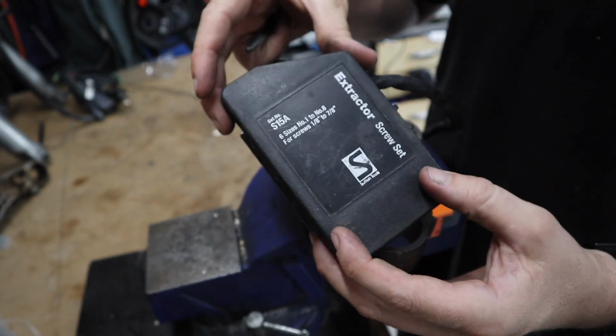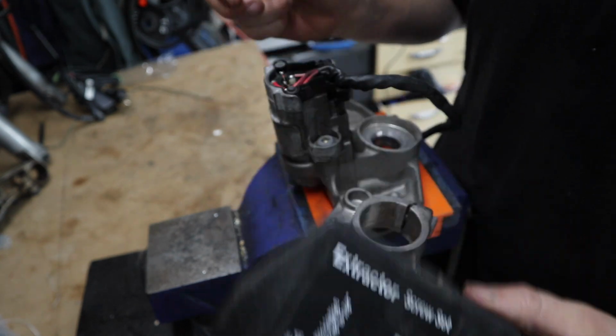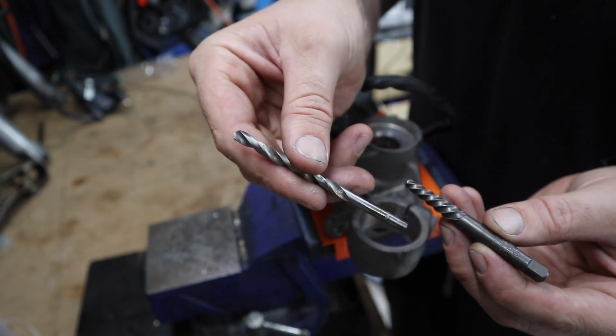They're not very expensive, and they're also known as easy out, so I'll leave a link in the description to the exact kit that I have. You just have to get the right size, and usually written on the shaft is the corresponding size drill that you need to use for it.